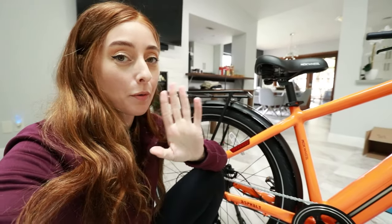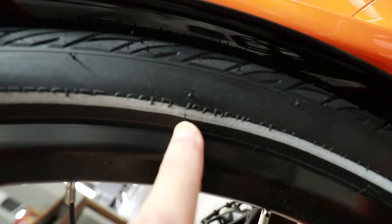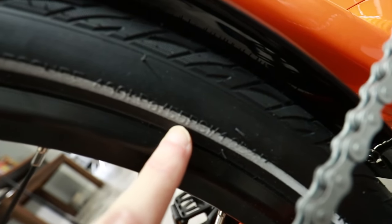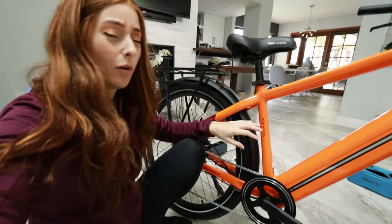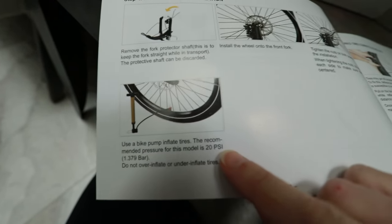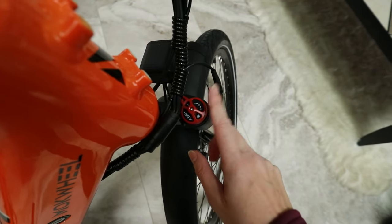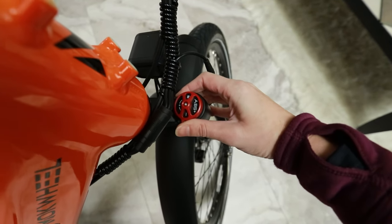One thing that was kind of hard to find was the PSI. Because of this little white strip, it's really hard to see. The minimum is 30 PSI and the max is 55 PSI. I had to look at both wheels on both sides to find the one I could read best. The manual says 20 PSI, but I'm going to go by the minimum that the tires say — 30 PSI. Because with fat tires it's usually about 20, but these are not fat tires. One more thing before I head out: you can adjust the front suspension. Right now it's fully open, and if I go like this it's fully closed.